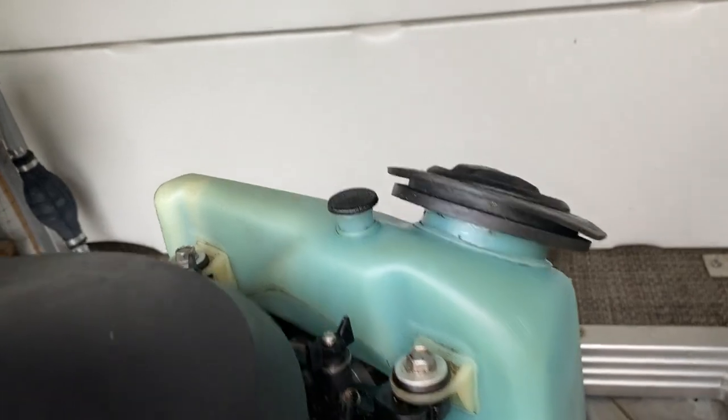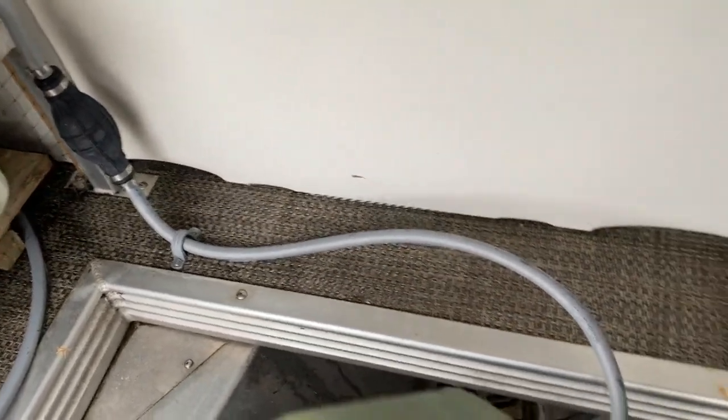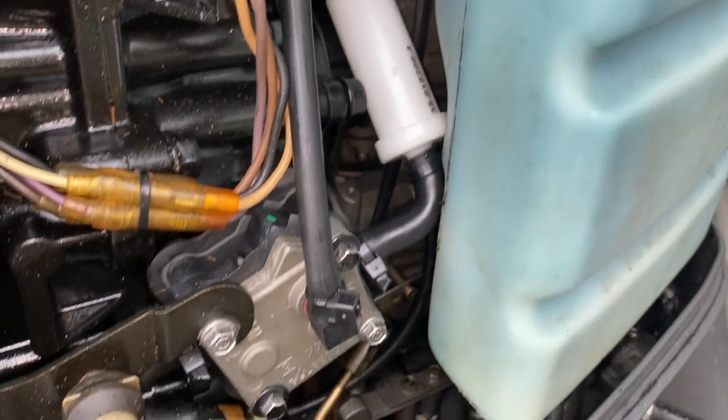Coming up to the front or inner portion — re-secure your fuel hose. I recommend maybe two to three pumps just to push that fuel through the hose and into the brand new fuel pump and into the filter, because that's empty.